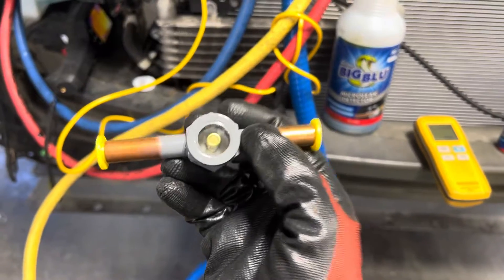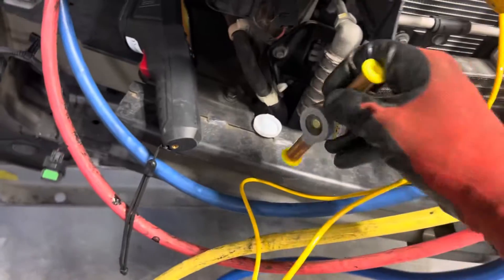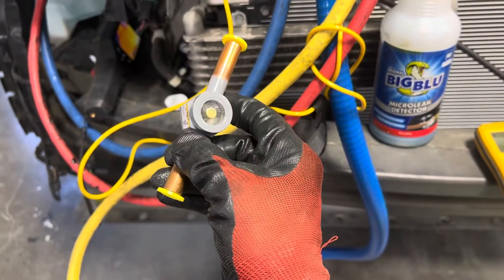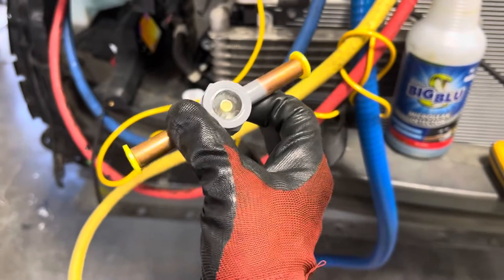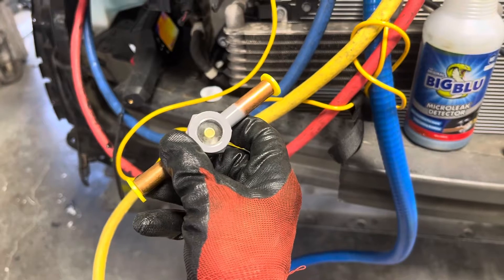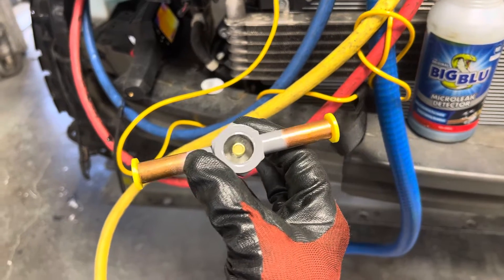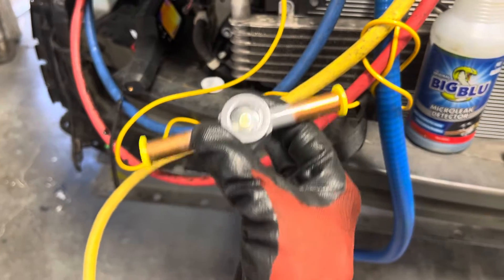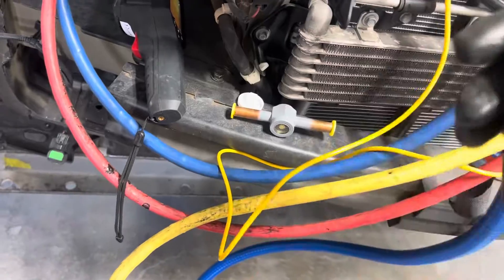And you will be able to physically see, visually with your eyes, when the system is contaminated with moisture. Especially if it's nice and green when it goes in — if you're a customer and you had one of these, or if you're a shop and it goes out nice and green then turns yellow, you know that so-and-so down the block with his AC machine just put back in moisture-contaminated refrigerant. And you can tell, every time.